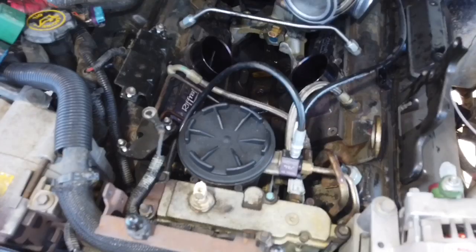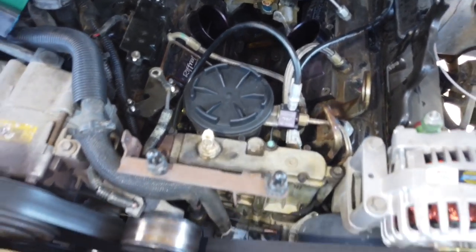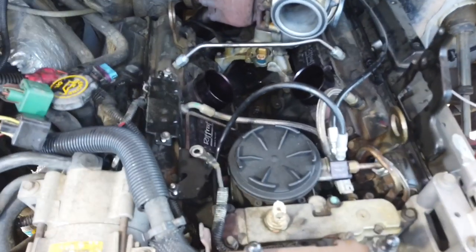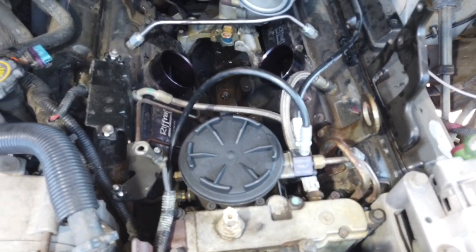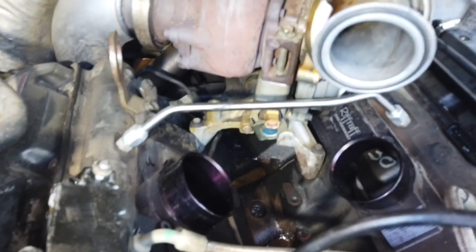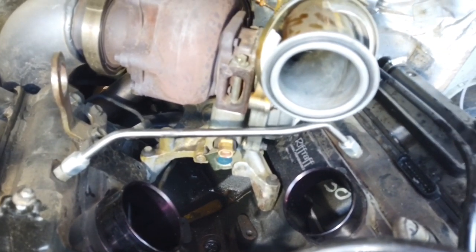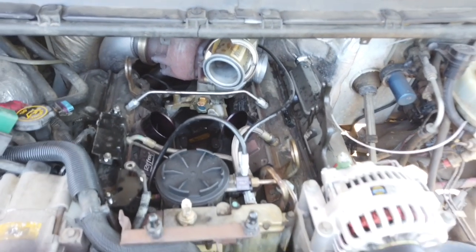It's not gonna leak. And I'm also gonna be removing the fuel bowl and the high pressure oil pump, because I'm gonna be changing the O-rings on that. So there's not gonna be any future leaks anytime soon. But right now what I'm trying to do is get to the pedestal and then remove the turbo, remove the pedestal, delete all that. It's going to be a perfect 7.3.